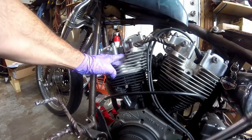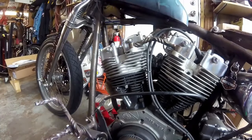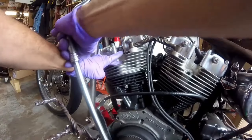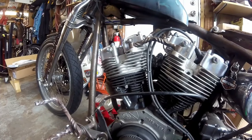I have no idea where this engine currently is, so I'll just give it a turn. Once it starts to blow air out past your finger, you want to get something and put it in the cylinder. I've seen people use a straw — that's probably a great idea — something non-metallic. I've always used a screwdriver and never had a problem.